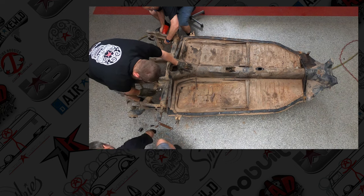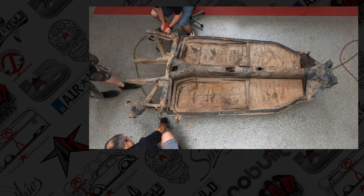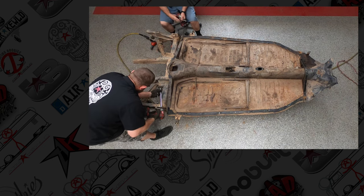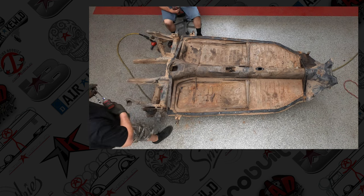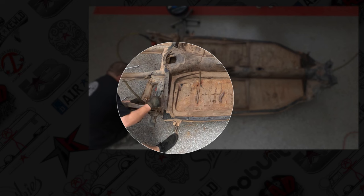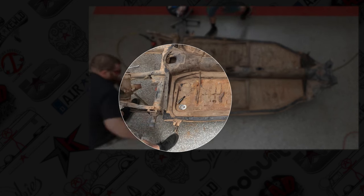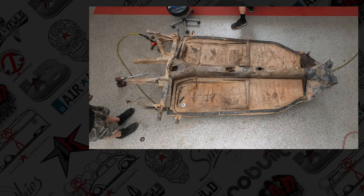So this bolt has two big, I'm not going to call them fender washers, we're just going to call them thrust washers inside, one on each side to kind of sandwich the bushing into the clevis, so don't lose the washers. So there's going to be a total of four big washers, two on each side, and the bolts, clean them up and reuse them again.